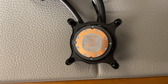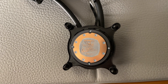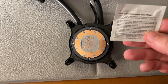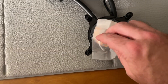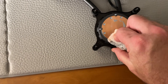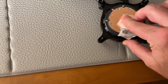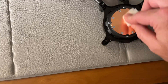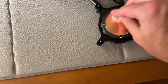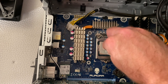It's now time to get messy and play with some thermal paste. Lens or alcohol wipes work great for removing thermal paste and are electronics safe. Thermal paste must always be reapplied whenever a heat sink is removed. Remember that the CPU must also be cleaned and prepared for a new thermal application.